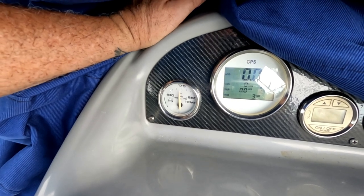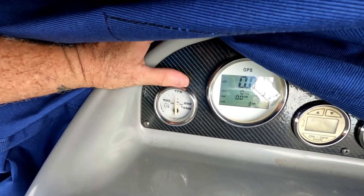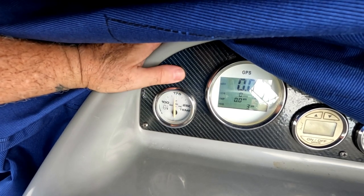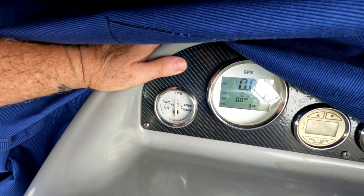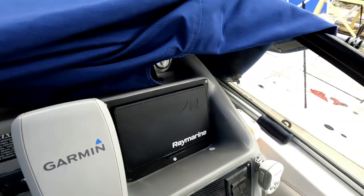This is the final flush. If you look at that temperature gauge, it's below 175 and hasn't rushed up like it did before. It's staying below 175 and that looks much better than a week ago when we went out and got overheated — way below 175, it looks really good now. We've been running for about five minutes and it's still staying below 175. This may be the solution to the whole issue. We have a sea trial coming up, maybe this weekend — as soon as we get out there we'll do a video. Thank you so much for watching, peace.